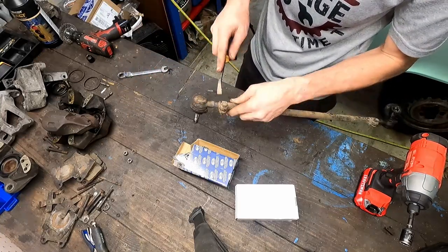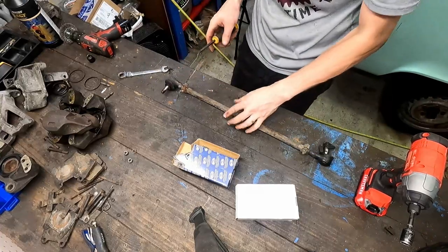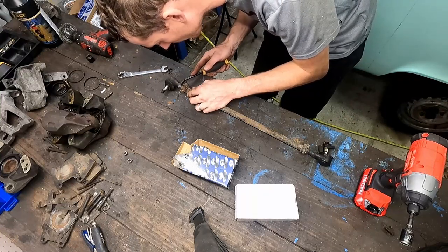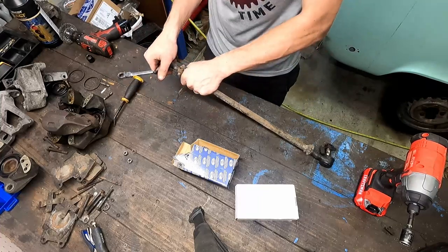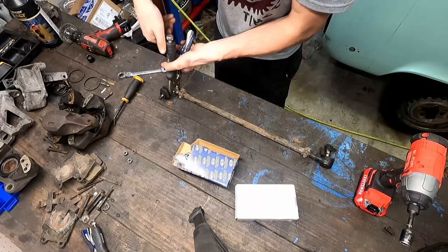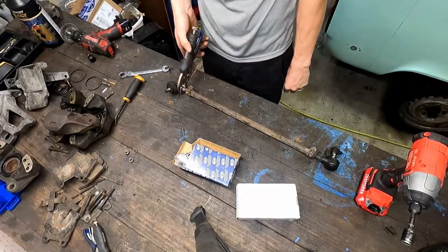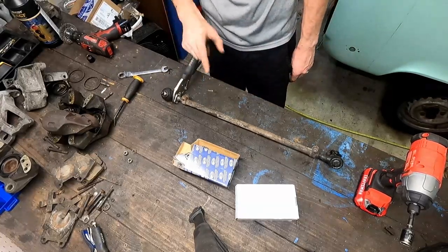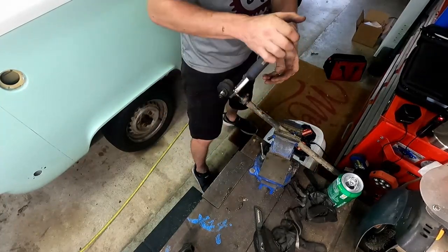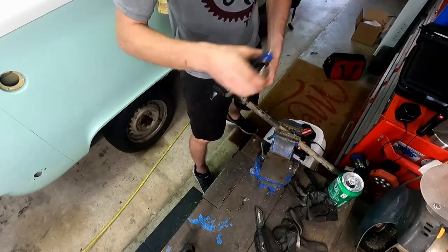Now that we've got it out and clean, I spread the gap a little bit to give it room to move. Looking at it, facing up, we've got one, two, three, four, and then what looks like five — it's really the thread that makes the neck. So five threads sticking out. I need some locking pliers to get this off since it's encased in there. We put it in the vice with a little heat and some PB Blaster — we've been able to take it out. I'm definitely doing these one at a time so I don't get them flipped and mixed up which one's which.